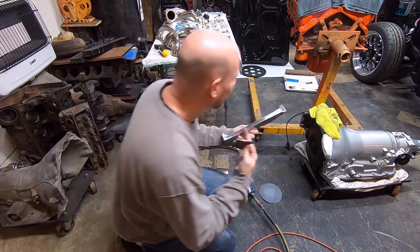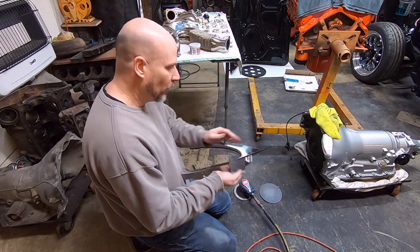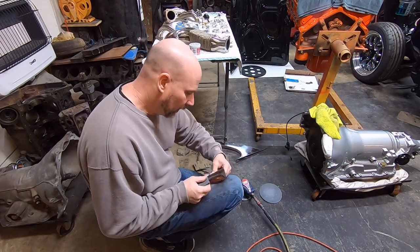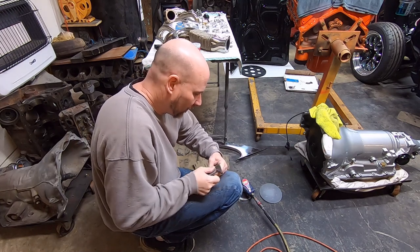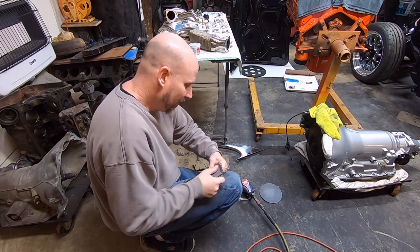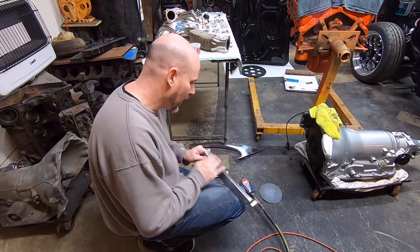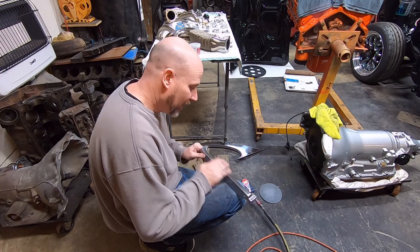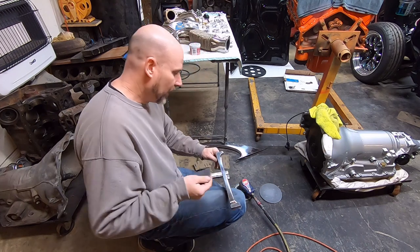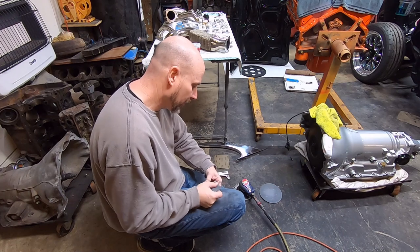If you do see scratch marks, you need to go back and do them again with the DA until you get them out. Don't keep continuing, because you're never going to get it. There are many, many guys out there that do this stuff for a living, and they are awesome at it. This is not something that I would want to do for a living. I don't have the hands or the fingers for it. But I can get some pretty decent results right here in my garage with very, very cheap tools.